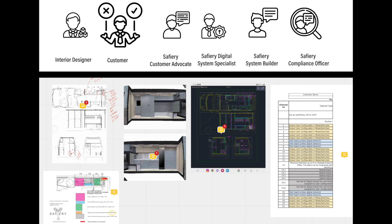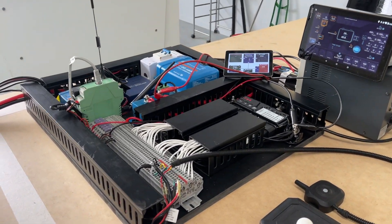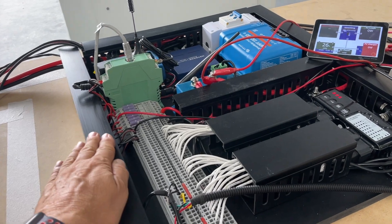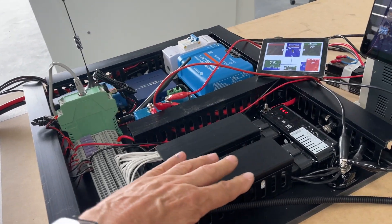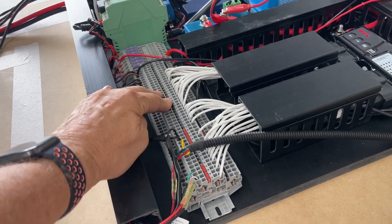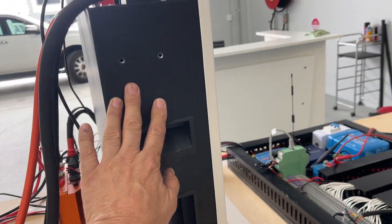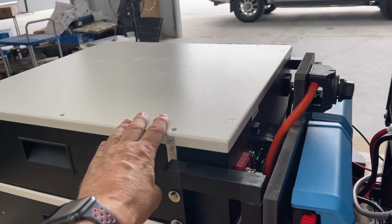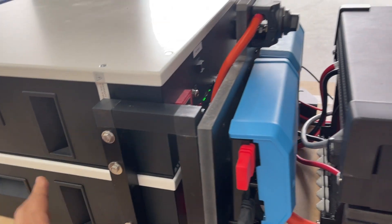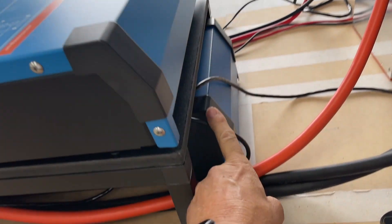Let's have a look at the build. This is for a VW Crafter being exported to Taiwan. We have the full Garmin in there — it will have a 10-inch screen when it ships. This board here is a control board sitting at the back. You can see our digital switching, and we've got WAGO fuses and WAGO blocks — very easy to install, much more compact than before. We've got three of the 4800 batteries, each equivalent to 400 amp hours at 12 volt, giving us three of those. We've also got a 240 volt inverter and a 120 volt inverter charger.